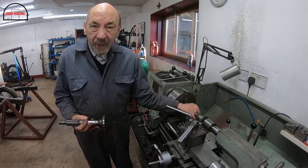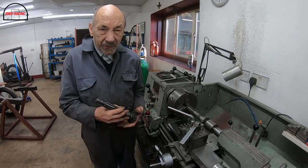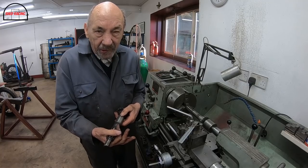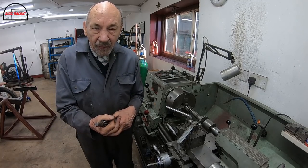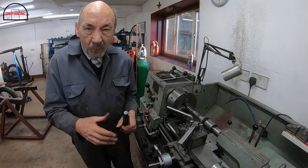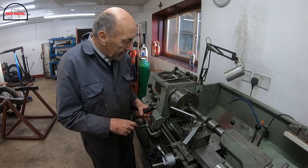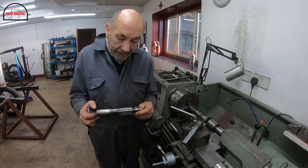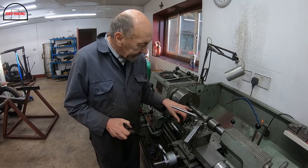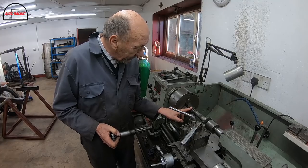And it worked fine, until we took it to bits this time and we noticed the clutch wasn't working properly, because I reckon the clutch is sticking on there, and then as the clutch goes in, it never sticks on the flywheel, never really works on the flywheel. So one side it was like brand new, the other side you could see it had a lot of use. So we just tried that in the clutch and it has got a fraction more clearance and it doesn't seem to be sticking on the root, it seems to be sticking on the outside.